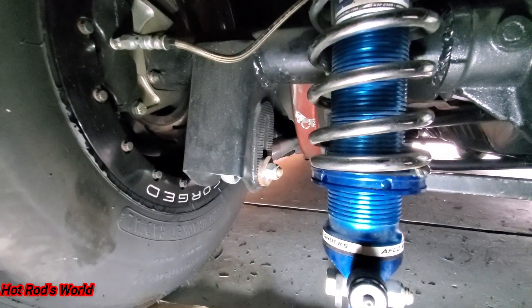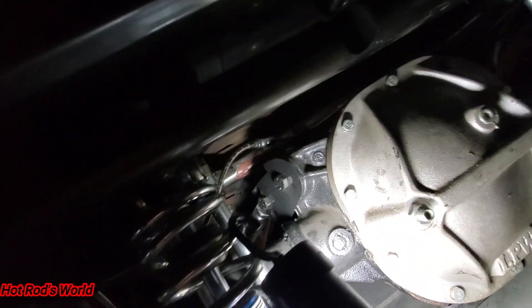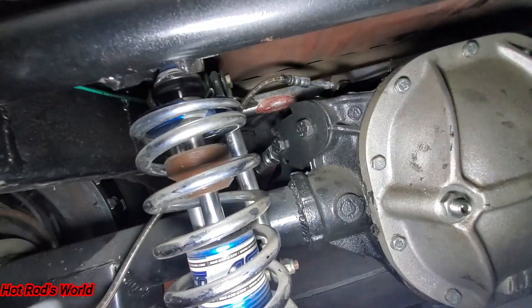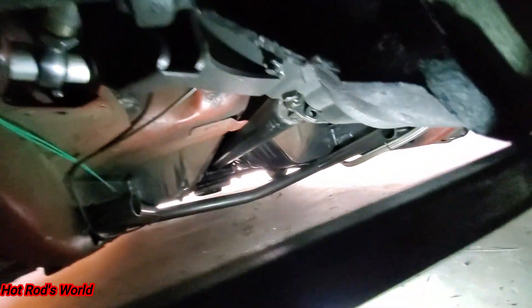Welcome back. In order to put this down in baselines, there are a couple of numbers I need. I have to get the center of this bolt to the ground, and the front bolt to the ground. I have a relocation upper — you can see here — and I need to get this upper control arm bolt right here. I have adjustment holes and I went up one, but you have to be careful because it was hitting the bar, so I got them to cut it out. I'll likely lower the front bar, and I need the location where this control arm mounts.